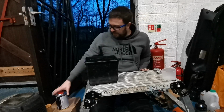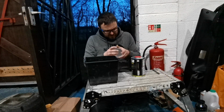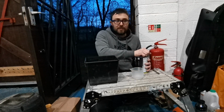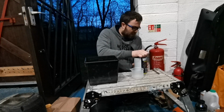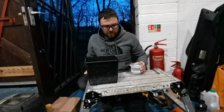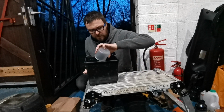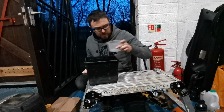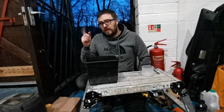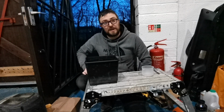So now all we have is the hardener. So I think it's, well, 237 mil, did I say earlier? 237 mil of that into the pot. We're going to mix it all up and spray them. Right, so that is everything in there. So I'm going to go ahead and mix that now. I'll get it in the gun and then we're going to get spraying. So yeah, next time you see me, I'll probably be spraying on this one. So let's get going.